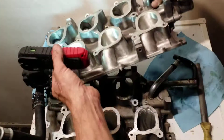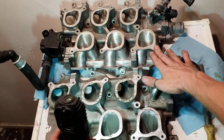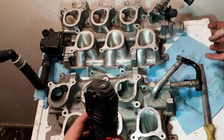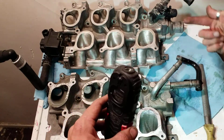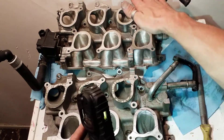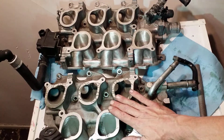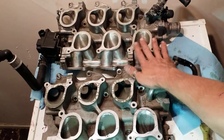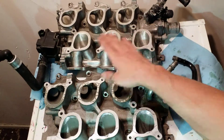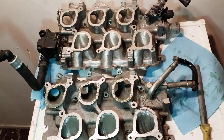Throw that on with your upper intake and your throttle body, whatever you want to swap out. I'm going to do everything on the upper intake and show you guys how to throw a throttle on there, because the only pain is that the throttle is a front mount on a Freestar. If you just want a front-mount throttle with the cable coming out towards your radiator, it's quick and easy, but other than that it's a pain in the ass — you've got to make a mount plate on the top. So this is the big difference between an OEM Freestar, a fully ported, polished, knife-edge ported lower Freestar, and your OEM Mustang. Have a great time building. Thank you.